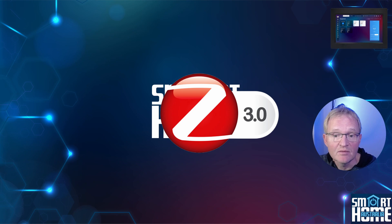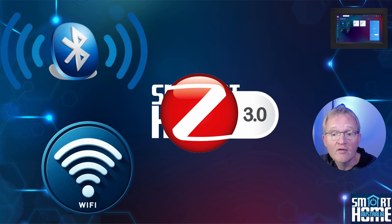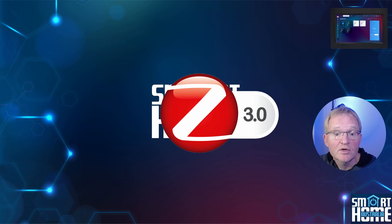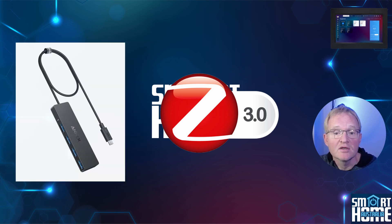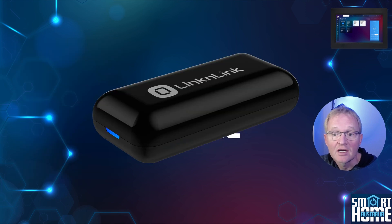Communications is provided by Zigbee 3.0, Bluetooth, and Wi-Fi using the 2.4 GHz frequency — range should not be an issue, although I'd like to see 5 GHz support included. Zigbee 3.0 is provided by the included USB dongle plugged into the single USB-A 2.0 socket, but you can also use it with a USB hub such as the Anker 4-port USB hub to get multiple USB connections for Zigbee, Z-Wave dongle, or thumb drive simultaneously. Use a USB extension cable and place the dongle some distance from the ISG for best results and to avoid interference. And if you pair this with the e-hub, you add infrared and RF to the mix.